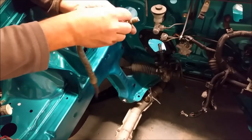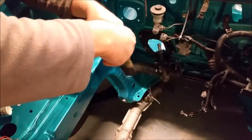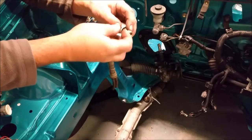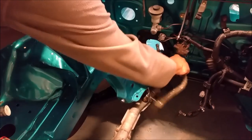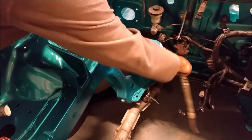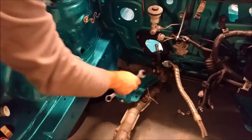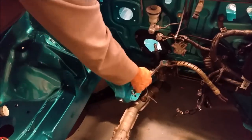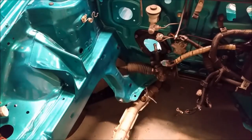So this looks like, I don't think it's a tapered gas thread. Some things like this have a gas thread on them, a tapered gas thread. So I'm just going to use some plumber's Teflon. And I'm using this tiny roll because it's all I've got. I've run out because I use this stuff quite a lot. Left these open. They should have been blocked off on the off chance that any sort of foreign debris got in there. But this is another thing which we can get to with engineering. But I'm just going to put it in now. So I have to get it in with the engine thing. Oops, I'm going to use the spanner this way. And again, we'll just thread that through there to keep it out of harm's way.